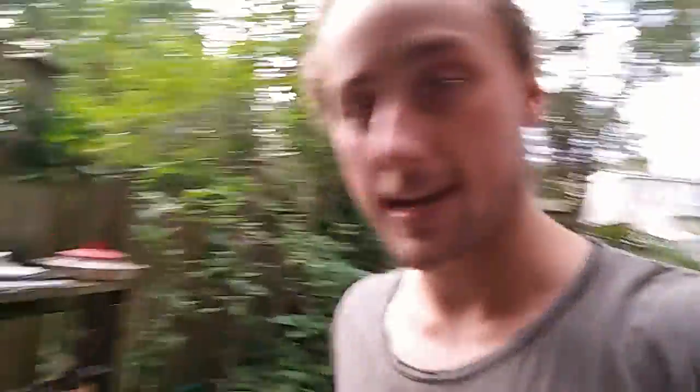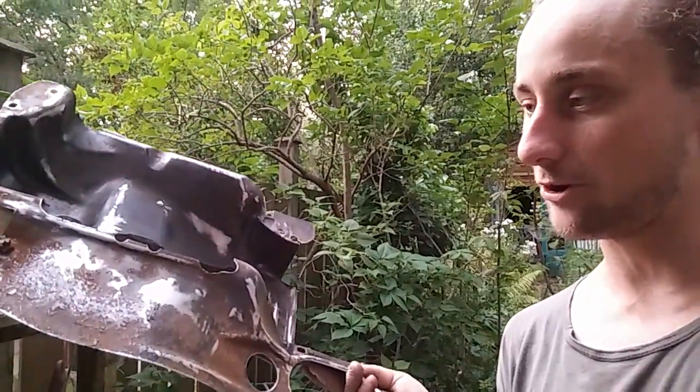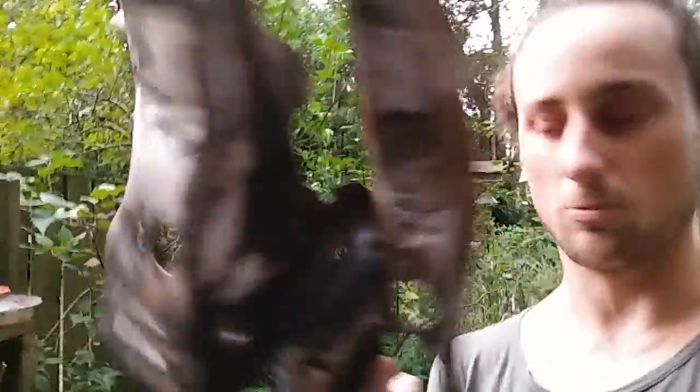Right now I'm cleaning up all my engine tins, as you can see. What we've done is basically gone over it with a steel brush — an electric steel brush on a drill — and then followed it up with about 100-grit sand to get it right down to the metal. This is just one of the pieces; as you can see there are quite a few more to go, and not all of them have been completely cleaned up with the brush and sandpaper yet.